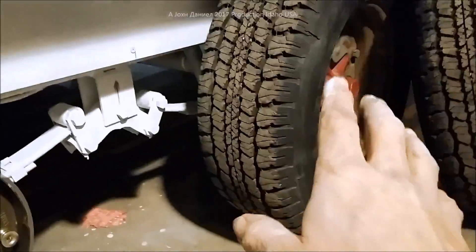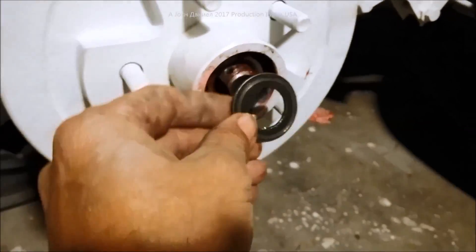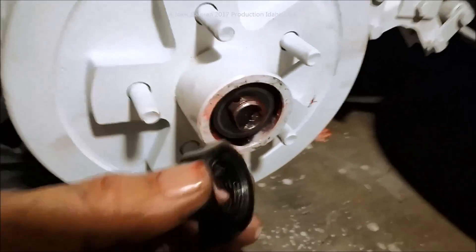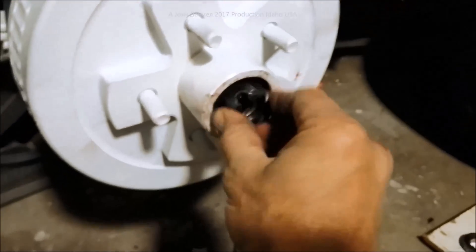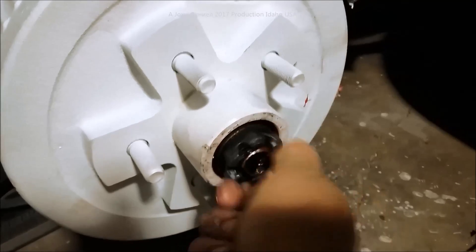Now let's get the bearings and the rest of this put together. The brake is on; we'll finish the wiring, put the hub on, and see how it looks with the new wheel. I've got the hub set on it — it isn't pushed all the way back yet and I haven't made up the brakes, but I want you to know that when you buy one of these kits, you're not going to get your washer, you will not get a cotter pin. The reason is simple: some spindles have a different thread count, some have a star-type washer. Your castle nut does not come with it either because it's specific to the thread count on your spindle.